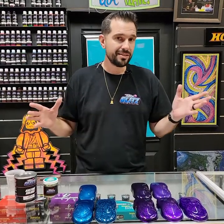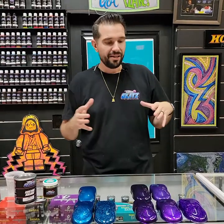You can shoot our flakes out of a 1.4, shoot two, three, four coats of a nice high solid clear and call it a day — no wet sanding or buff if you really want to skip that. The biggest benefit is the luxury of having this full flaked look without struggling with it, and you can do this with all our custom colors of flakes.